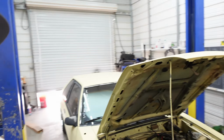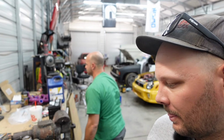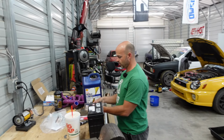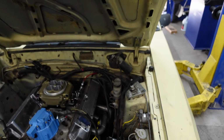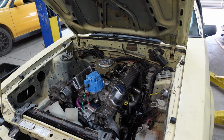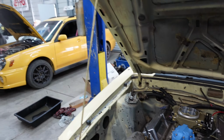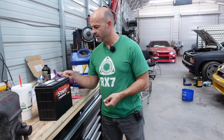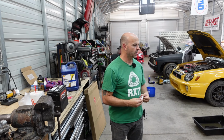The Sniper's really easy to wire. There's like 4 or 5 wires we figured out. One is 12 volts, one is ground, and one is 12 volts switched. So that's why we're getting the battery in here, so we can find 12 volts switched real easy. Bo cut a bunch of stuff down, so we might be digging into that big harness back there to find it. This is probably gonna be pretty simple. The alternator's probably gonna be our biggest headache, if a headache at all. I mean, it's 3 or 4 wires. I think I already looked up a little bit about how to wire it up, so I kind of have it in my head, but I'll probably see if I can find another diagram just to be sure.